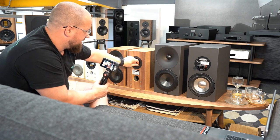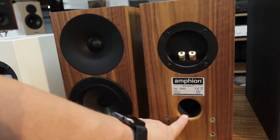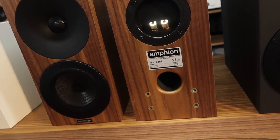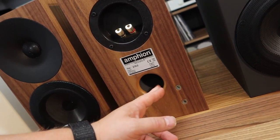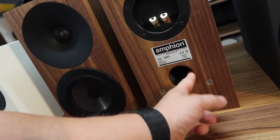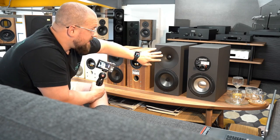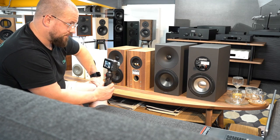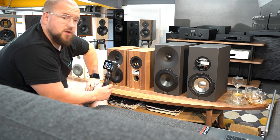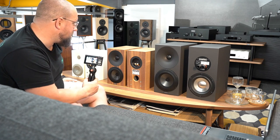It's a nice quality binding post — what you'd expect at that price point. I really like that the ports on all of them are extremely smooth, not a push-in port which sometimes creates a lip inside or on the outer edge that affects how the port sounds — turbulence in a port is extremely important to get right. This is a free-flowing, almost CNC-looking port design with a routed round-over on the outer edge, clearly well thought through. The waveguide works brilliantly — the huge sweet spot you get with these speakers is really something to behold, very large and comfortable to sit in.